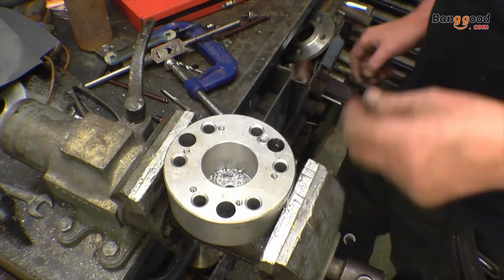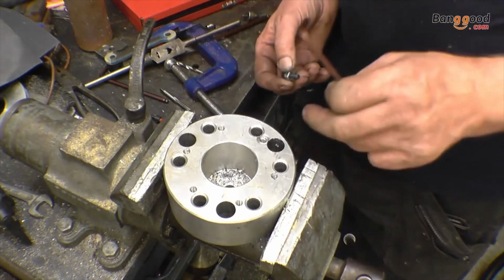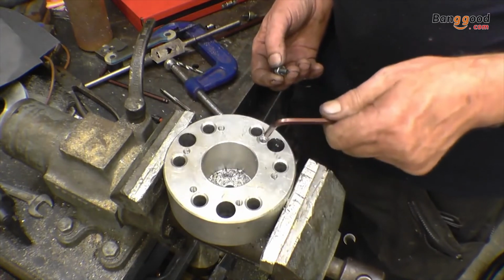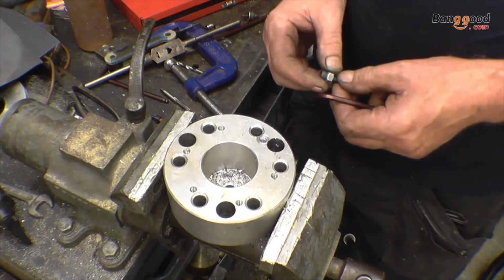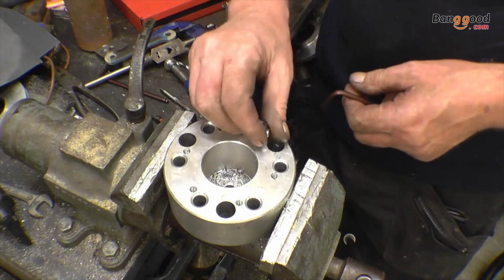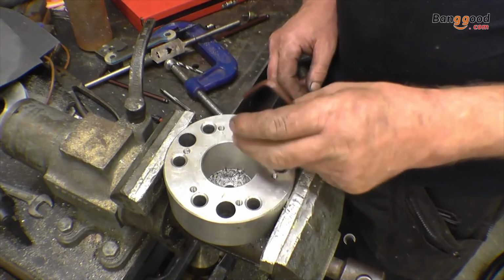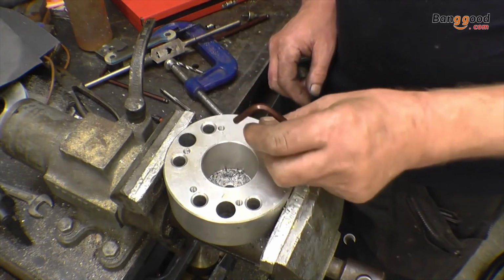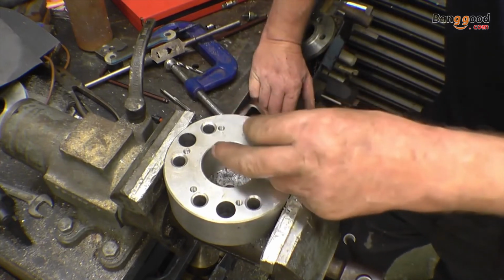I used to work on racing car stuff, gearboxes, fuel and gearboxes, magnesium casings, and all the threads were helicoiled, had inserts in from new. I mean, basically bolts in aluminium aren't designed to go in and out loads of times, they're basically assembled and then that's it.